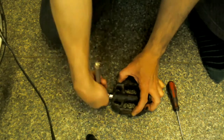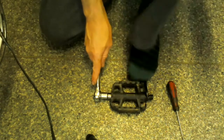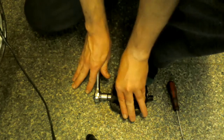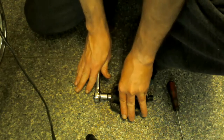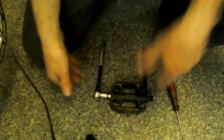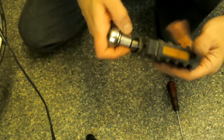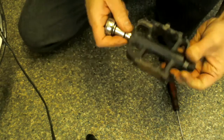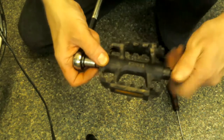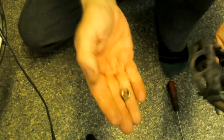and then there you go. Now I've got the spanner on holding the one side, which sometimes I actually put my foot onto, and then I'll put some pressure down, hold the pedal, put some pressure down on the spanner with my hand. There you go, and it just cracked open then. So now I can take that one off the back. Use this neck spanner now, so you can pretty much turn the back end and hold that still if you want. Get that nut off. Here you go, it's come right off.